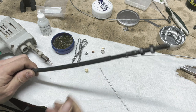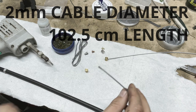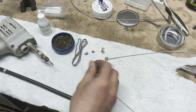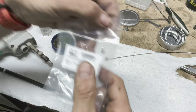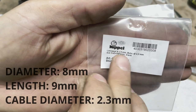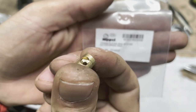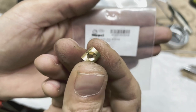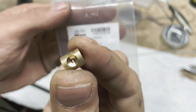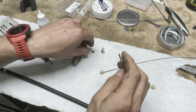We just need to keep the outer part of the clutch cable, then a 2mm stainless steel cable with a length of 102 centimeters. We also need these ends — these are my new flashy ends which I really like. The correct size is 8.9mm with a 2.3mm hole — a pretty cool-looking brass piece. They're a bit expensive at two euros each, but compare that to the price of a new clutch cable. This end goes on the lever side.